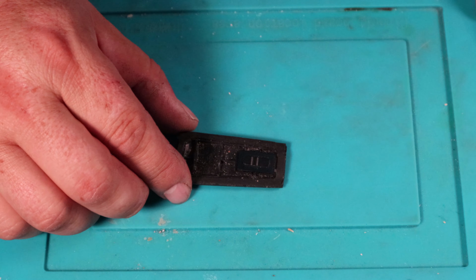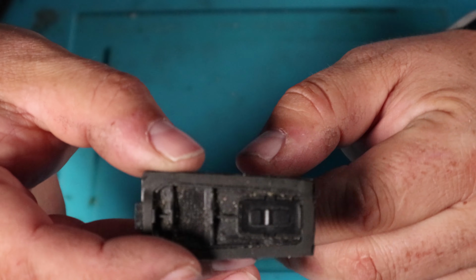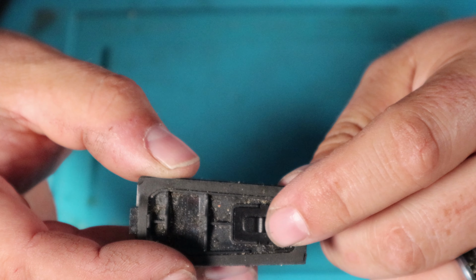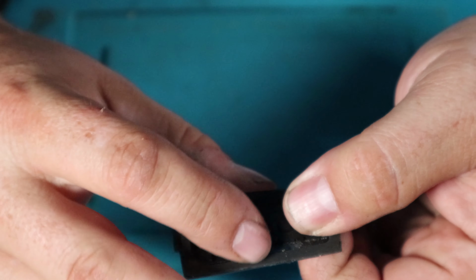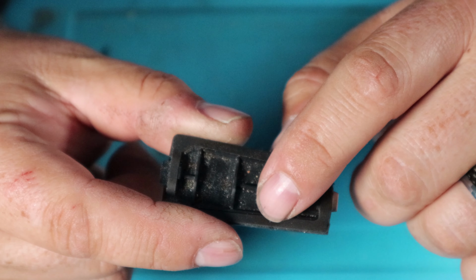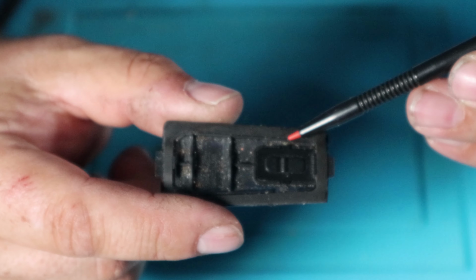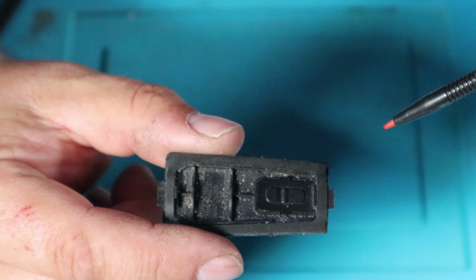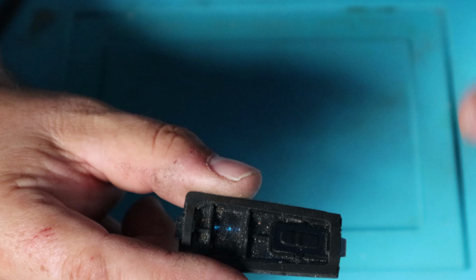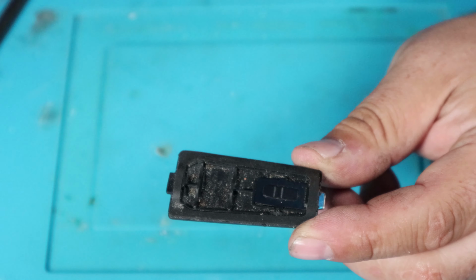Okay, so what I have here is a lid to one of my Testo Bluetooth gauges. And if you look closely, this piece of plastic is actually housing a spring tension metal doodad right there. And it was glued before right around this perimeter. Mirror image. So it was glued right around this perimeter here. And that glue joint has since come loose, which means the whole lid mechanism is not working correctly. So what I want to do is re-glue this and reinforce it with the baking soda technique.